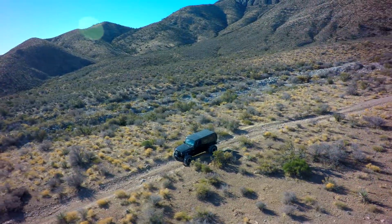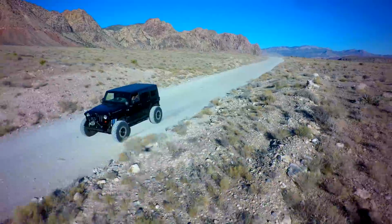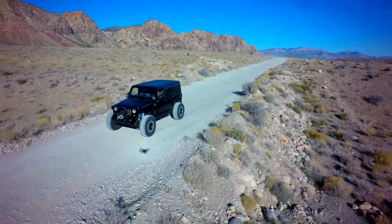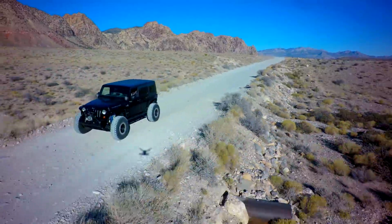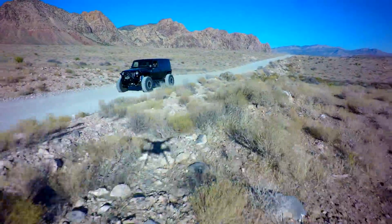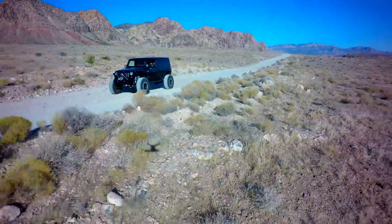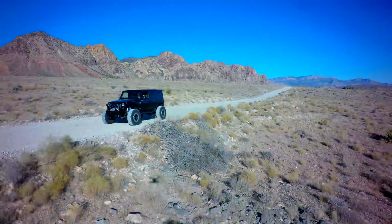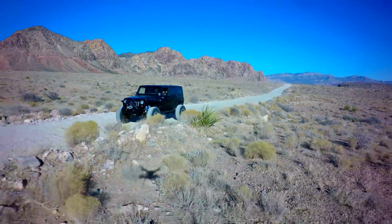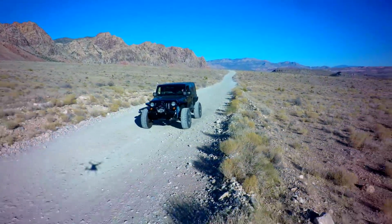Power steering is all over the place, depending on if you're using PSC. The Jeep I'm driving right now has a Howe Racing setup, hydraulics. It feels pretty good. We use Redneck Ram, we use Howe, we use PSC, and there's a lot of different configurations. The gearboxes are different where they're ported. Let me say that if you're going to be doing hydraulics and you call up PSC or Redneck Ram, let them know that you have a V8, whether it's a Hemi or an LS, so they can port the box properly. You don't want the ports coming straight out the side and into your motor, so they'll port them out the bottom.